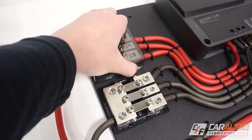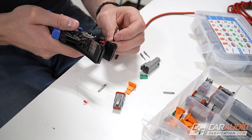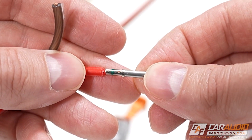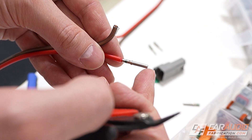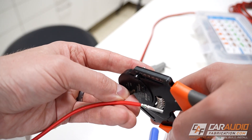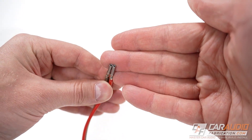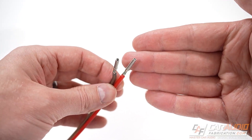New Concepts has a wide variety of different speaker wires, power wires, and signal distribution wires for your next car audio system, along with power distribution accessories so you can completely wire your custom build. To learn more, check out the links in the video description. So first off, we're going to strip the insulation from our wire. These barrels have a small little hole that allows us to verify the wire is deep enough inside the barrel connector. If you strip away too much insulation, that's where the flush cutters come in handy — trim away the extra wire so it sits flush with the end of the barrel touching the insulation. To crimp, simply slip the barrel inside the specialty crimp tool, make sure the wire is pushed in deep, and squeeze the crimper to get our crimped barrel connection. Notice we've crimped the same barrel style to both the positive and negative connections — these are our female contacts, going into the male plug.